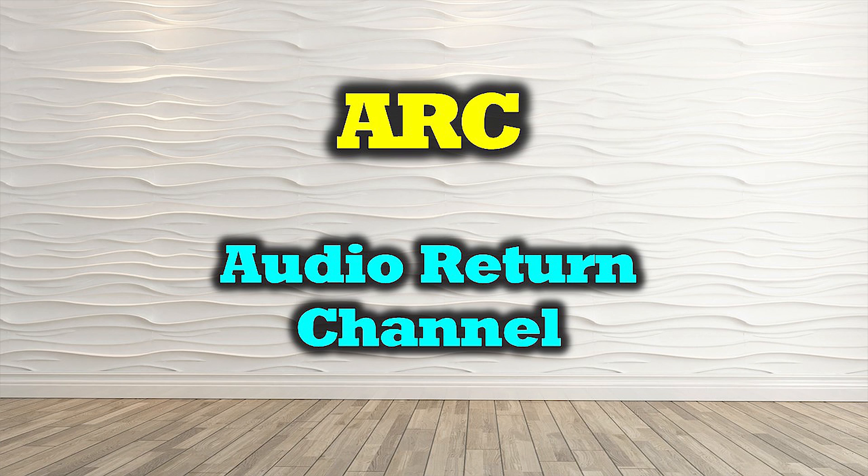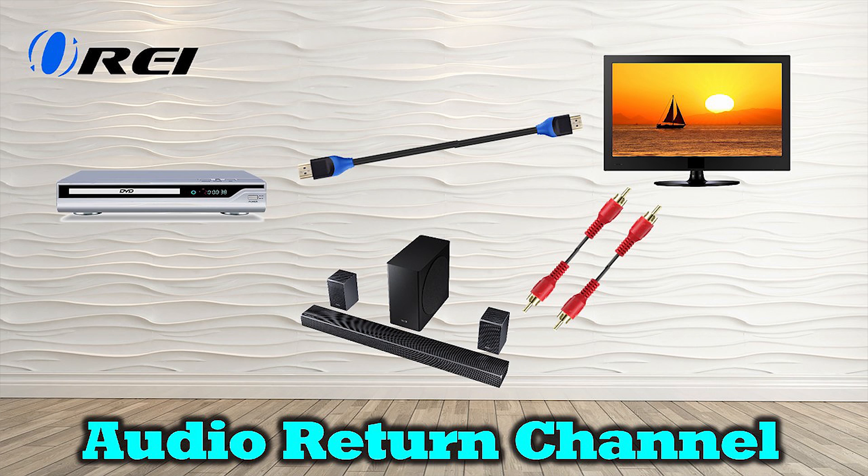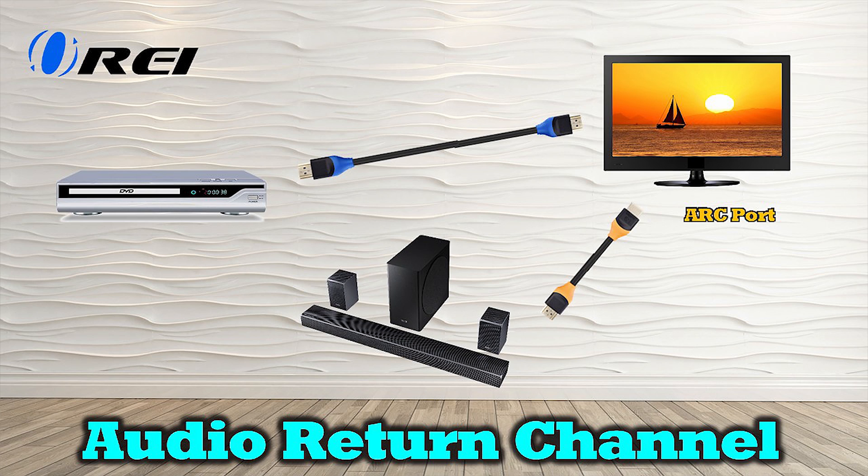This first feature will greatly simplify your audio setup. ARC, or Audio Return Channel, is a feature of HDMI that allows you to simplify your cable connections with newer audio equipment. With older systems, you would connect your media device, like a DVD player, to your TV with an HDMI cable, and then connect the audio from your TV to your sound bar with an analog or digital cable. With newer ARC-compatible gear, you're still making the same HDMI connection between your DVD player and TV, but can also make a second HDMI connection from the ARC port on your TV to your new sound bar. This allows the TV to send the sound from whatever content is being played directly to the sound bar, and if you change inputs, the sound for that new input is sent along to the sound bar as well.